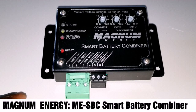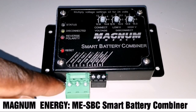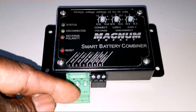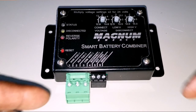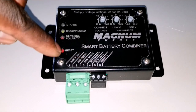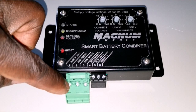One battery connects here and the second battery connects here — you can see it on the diagram. You have an auxiliary positive terminal here; this goes to the positive side of the second battery. Underneath you have a bus bar for the negative terminals, which ties the two batteries together. They're not paralleled — one battery's positive comes in on the auxiliary side, and the main battery is here.